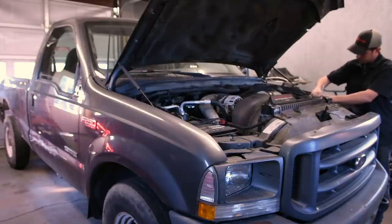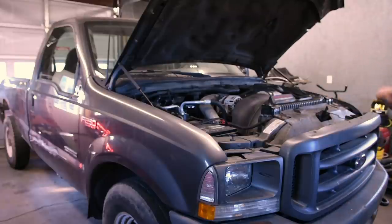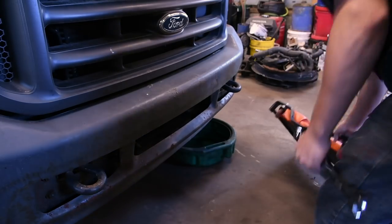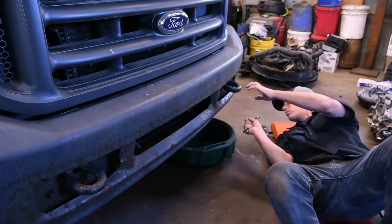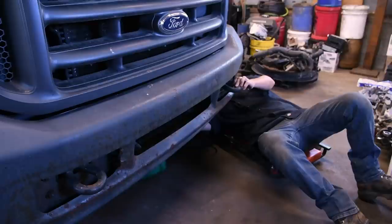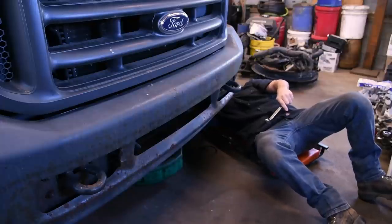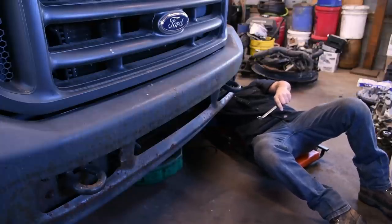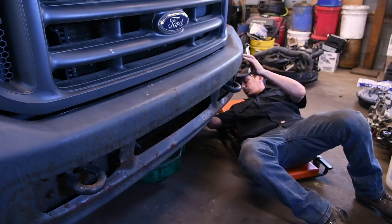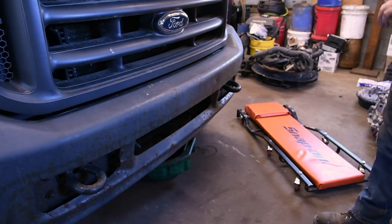Now, while we're on the subject of coolant, the real benefit to one of these coolers is it uses the coolant to help maintain the proper oil temperature. Some of the aftermarket kits that have an air to oil cooler have a little bit of a hard time regulating the oil temperature. From the factory, they use an oil to coolant cooler because the cooling system is so large, has a good thermostat system and fan system, and it really helps regulate the oil temperature properly. You have to remember, your oil operates best when it's at operating temperature. You really don't want it any cooler than that, and you really don't want it any hotter than that for optimal performance.